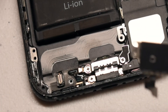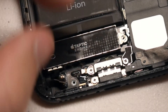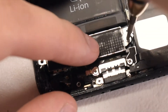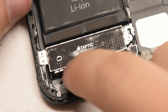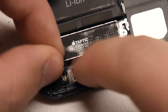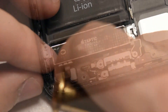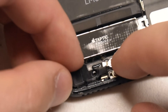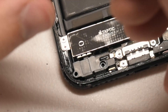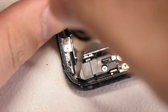Reassembly. Place the Taptic Engine into its socket in the correct orientation, and secure it with the three Phillips head screws — one on the right and two on the left side. When the screws are secure, go ahead and reconnect the ribbon cable. Make sure it's firmly clicked in. Now place the ribbon cable cover over it, make sure it's nice and tight in its socket, and reconnect the two Phillips head screws to re-secure it.